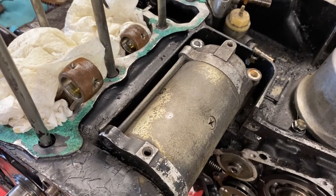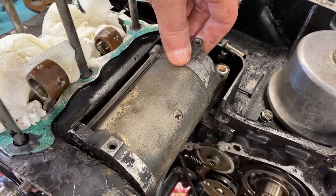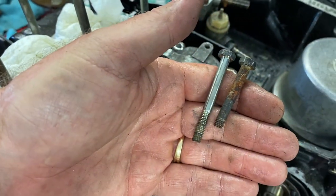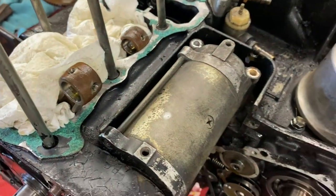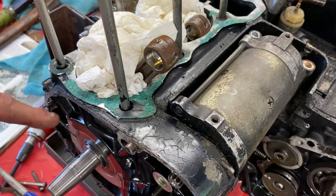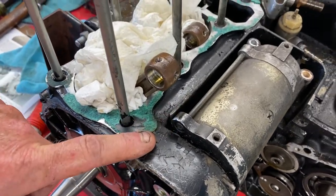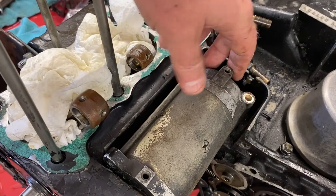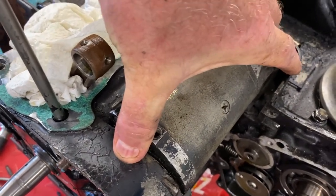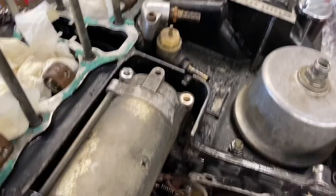We got our first major uh-oh here. I went to get the starter out and one of the long starter bolts broke — I just didn't realize it was so corroded in. There's about a half inch of it still sticking up, which acts as a restraining pin. The starter needs to slide out this way, and there's nothing else I can separate to get it out. Even splitting the case won't help me because this is in the upper part of the case. I have a little bit of movement up and down but not much, and I can rotate it a little bit left and right.